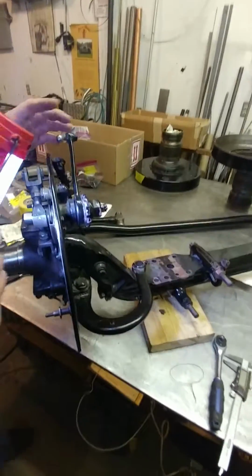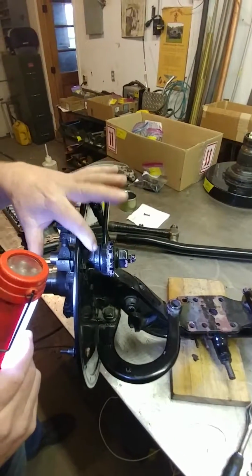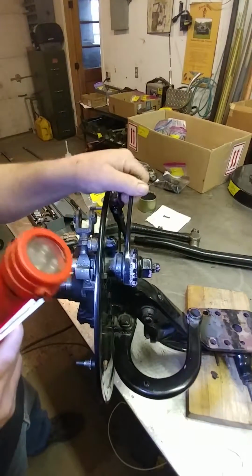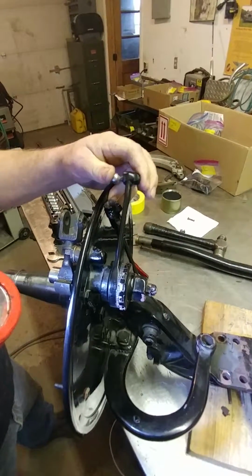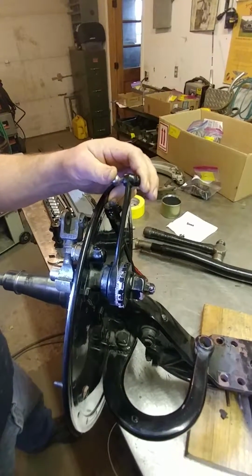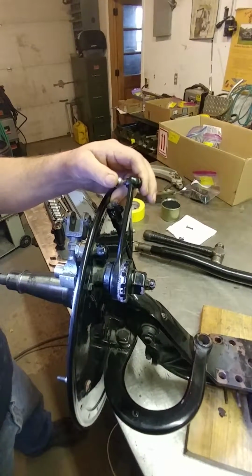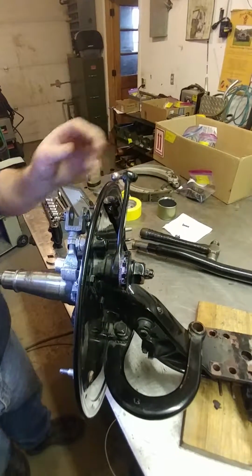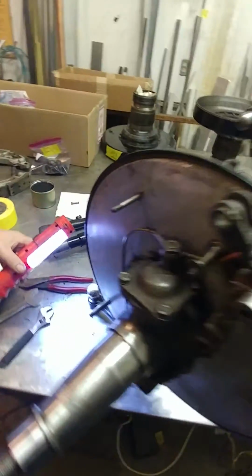We're also looking at our front brake cross shaft. This runs through a pair of bushings. On some chassis, this is also babbited on one side, and we can see considerable movement in this bushing, and that is movement that should not be there. That should be a perfect fit with a couple of thou clearance. That will also cause braking issues, either chattering or just simply causing extra movement in the braking system before the brakes actually come on.